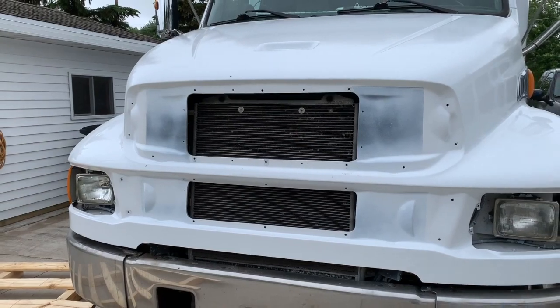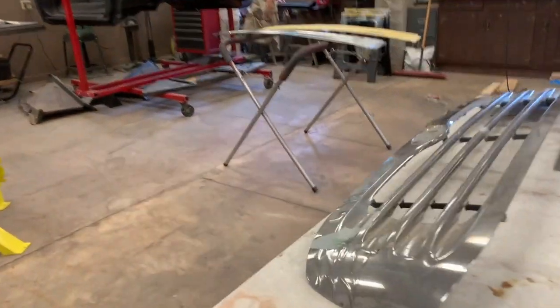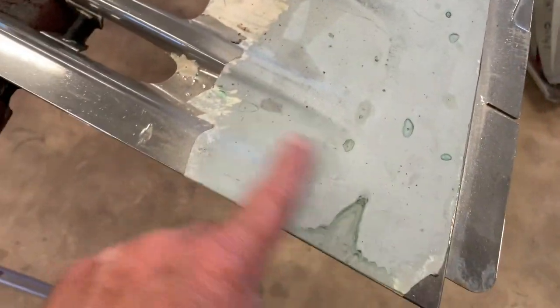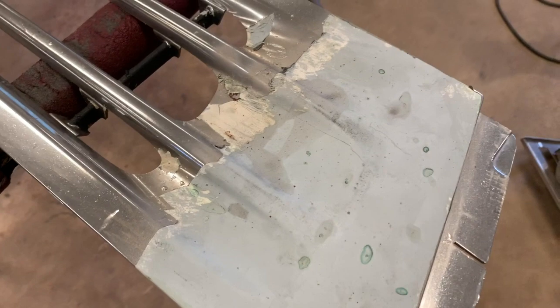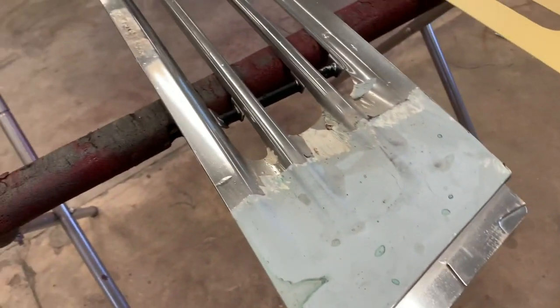What we found is that the grills in this thing are chrome, and they're chrome over the top of plastic. Many of you have probably had the same type of problem — you can see right here this plastic gets all funky. It's basically plastic with like a chrome cellophane over it. I tried several different things: I tried grinding it, which didn't work; I tried sandblasting it, which didn't work; and I tried chemical strippers, and none of that stuff seemed to work.